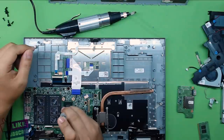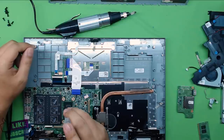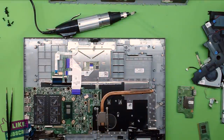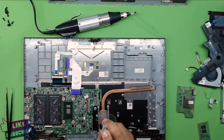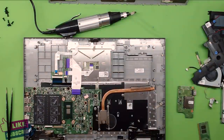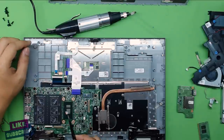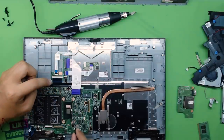Place a little thermal paste on top of the CPU. Not too much — just rub it in. You don't need big drops; just enough to cover it. On the heat sink I'm going to place a little bit on the copper area. With your tweezers, grab the thermal pad by the corner — try not to touch the middle — and place it right over the chip.